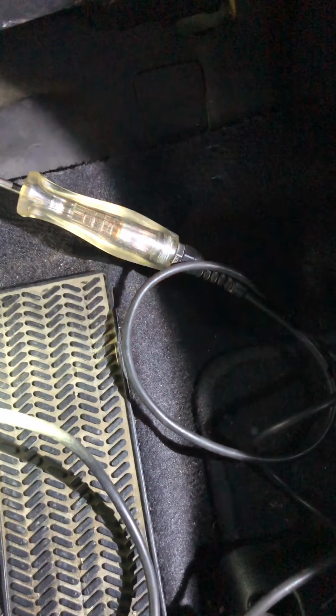By the way, it's not very bright. I should actually be taking a voltage reading. Okay, you see that? If I go full, that's how it looks. But you should never have that variance in voltage. It's just not the way the system was designed. Anyways, see that? I found my problem. If I wiggle my ignition switch, see that when I wiggle it?